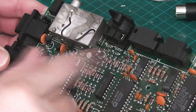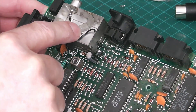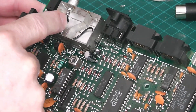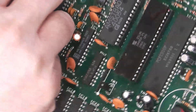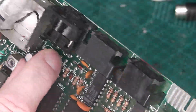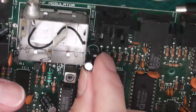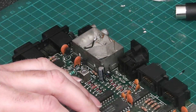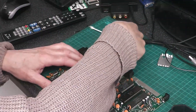I found this on the internet — I'll put a link in the description below. Basically I've taken all the modulator board out and it's just a single wire connected to the RF socket. It goes round, comes out of a little case, and it's actually soldered to LK2. What that does is it gives you the AV output like you get from the 48K Spectrum.